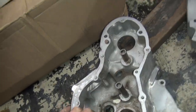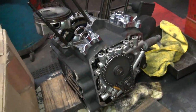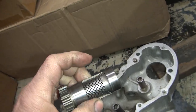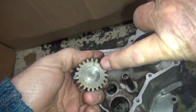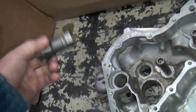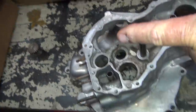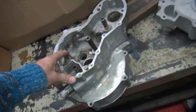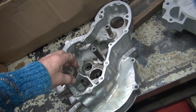These motors are done differently because they have a different system, but it's still a breather - a new improved design, more splash everywhere. I like putting reed valves in there because we're not depending on the breather to open and close in the correct position, which is called breather timing. A reed valve goes by pressure differential - it's either got pressure or doesn't. There's a timing mark right here - you used to go in there and cut the windows out, that's critical. If you put a reed valve in there, it opens and closes whenever there's pressure. When it's neutral pressure it does nothing, positive pressure it opens, negative pressure it closes. That breather valve has to be timed properly - if you don't have that mark lined up it has what they call oil carry-over, which keeps oil in the sump. That's called wet sump.